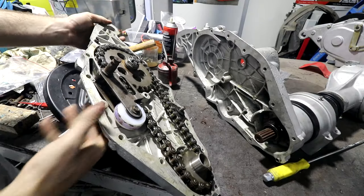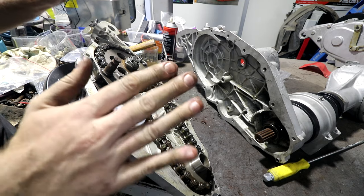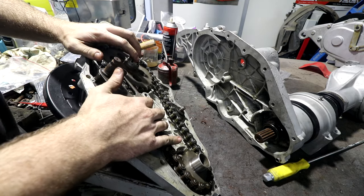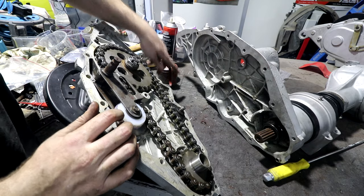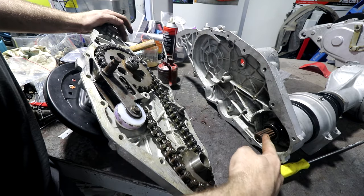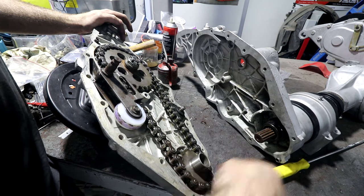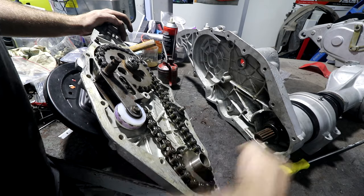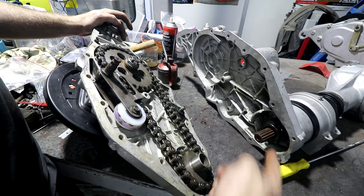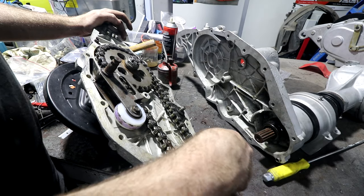This is where this is all starting to get a bit big for my bench. I'm running out of space. But this is our sealed oil in here. Obviously, we need a seal that goes around the outside of this, which is a gasket. Our oil could slide down the splines in here to escape from this, so we've got our O-ring in here to stop that. The oil could move down the outside of this sprocket to get in there, so this seal here prevents that.